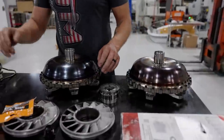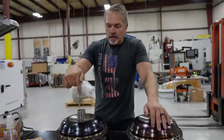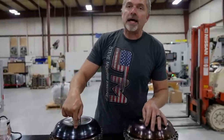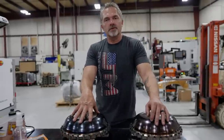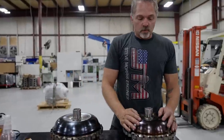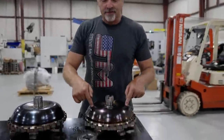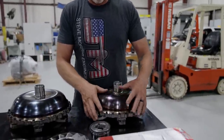Let's go over here and look at the converter and I'll give you a quick tech on this converter. You can come back and see the full video on the transmission removal talking 100% about the converter. Here is the table of converters, as I call it now. I'm working with Marty Chance, working with Car Rossler. This is the converter that came out of the car when it got so hot it turned stainless steel blue-black - that's actually mostly black. That takes about 900 degrees to do that, point blank. We changed some routing. Marty Chance sends me another converter - let's try this, we got to figure this thing out. This converter comes out and I knew that we were 600 degrees, and lo and behold, this is 600-degree temperature color. This was brand new stainless steel - all you gotta do is go back and look at it. It turned this color. It has to be that hot.